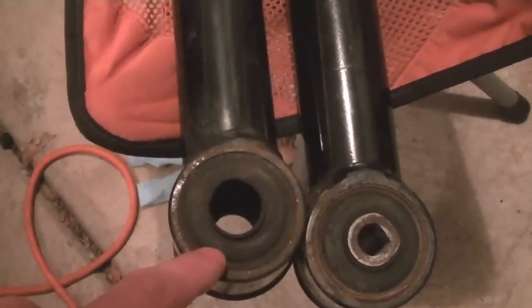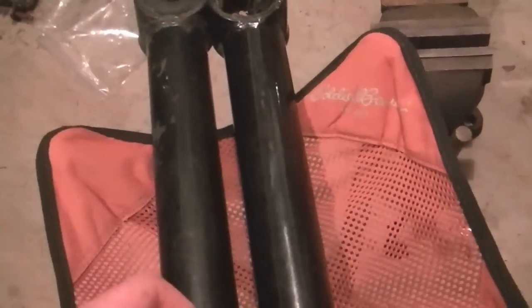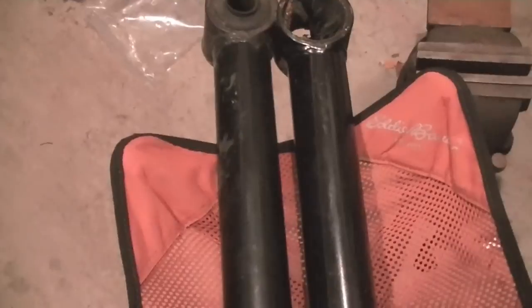We got the track bar on, but unfortunately I can't seem to get these bushings out because the control arms are round, and when I go to press them out they roll all over. So I'm going to need to get some U-bolts, bolt it to the press, and get a big bolt and some large washers to try and drive these out. These just fell out, so we're going to try that tomorrow. More will happen tomorrow — thanks a lot for watching. Please rate, comment, and subscribe.